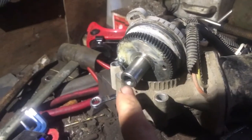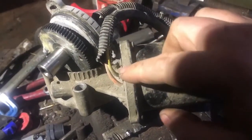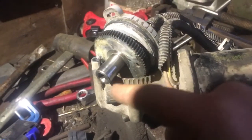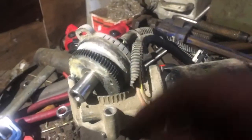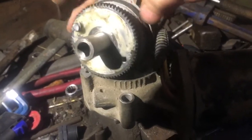So here we have the big gear, and in here we have the triangle gear or triangle slot, which is your four-wheel drive. This is a motor — it seems like a wiper motor. All it does is spin in either direction, and that's how it goes from two-wheel drive to four-wheel drive to low range, or the reverse of that.